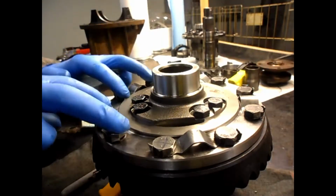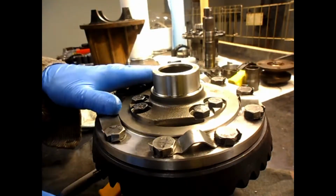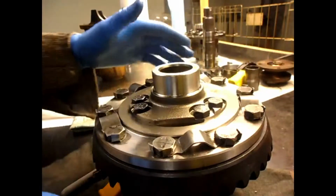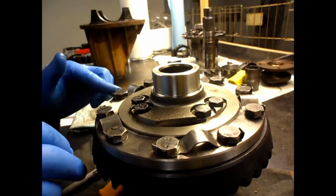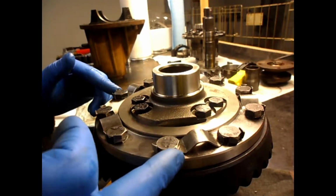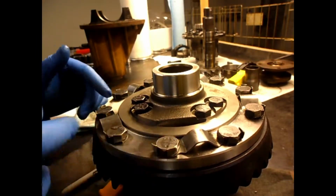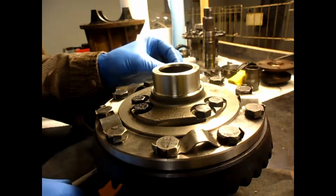Okay, all the nuts, 10 nuts, are tightened to 71 foot-pounds with some gear oil on them. And the little safety clips are all staked over. The ones that can be staked onto a flat surface, stake them on. The ones that are in between on a point, stake the side that would tend to tighten the bolt. Concentrate on that side. That's what I did. That's what I heard as a hint. Stake the tightening side.